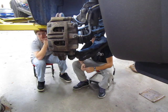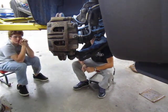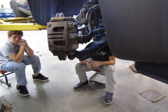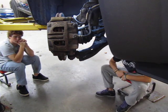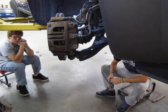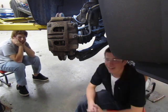First off, let's understand where the movement is in the ball joint. The ball joint cup itself is mounted to the lower control arm, and the stud mounts into the steering knuckle. So those are the two parts that we have to measure between. I'm going to show you first what we call up and down, or axial, movement.